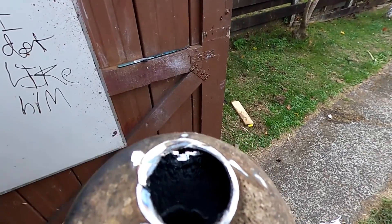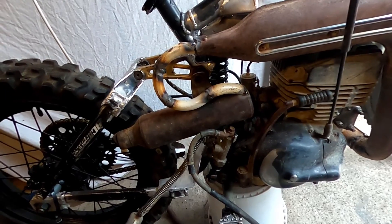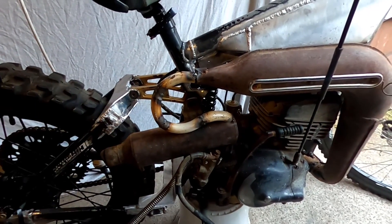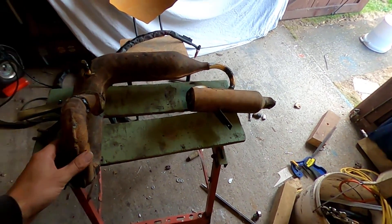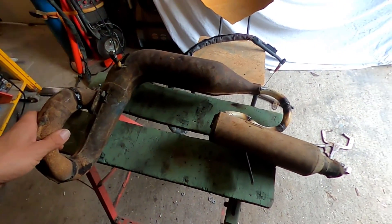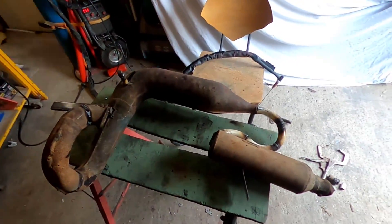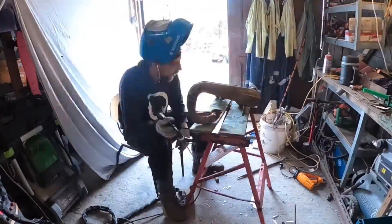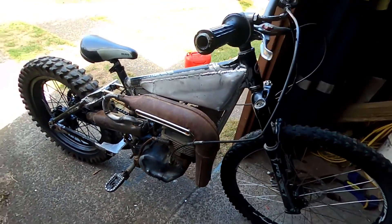The muffler's got a false back on it and I drilled through just on the edge - that was lucky. Look at that exhaust - how ugly is that exhaust? Does it look entirely horrible? Maybe I should redo it anyway - it'll be enough to ride it around. Put a comment below on what you think I should do. I've got it off, all tacked up, but now I've got to go around and weld the whole thing with the stick welder. I can't use TIG because it's too dirty and I don't have a MIG welder, so it burns holes through really easy - cue the time-lapse. The exhaust is welded off and on there now - actually I don't think it looks too bad. Time to test ride.